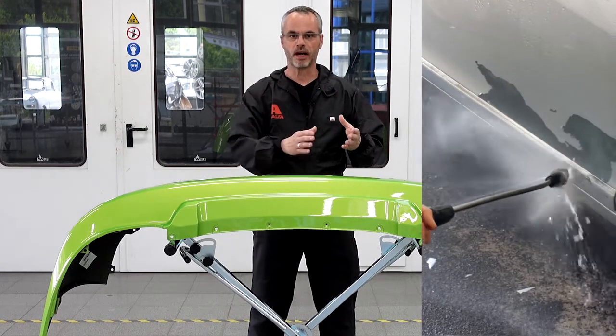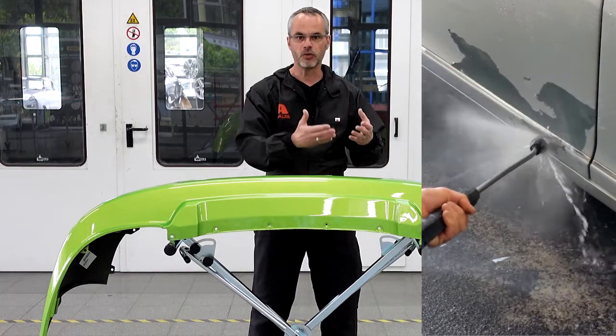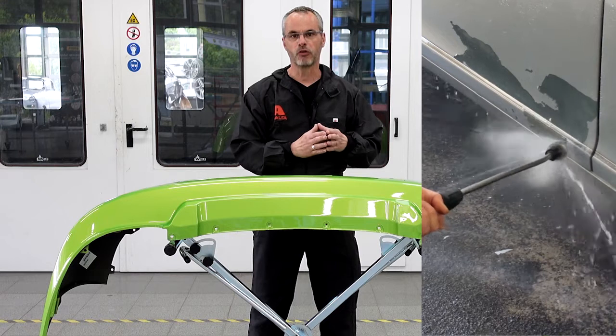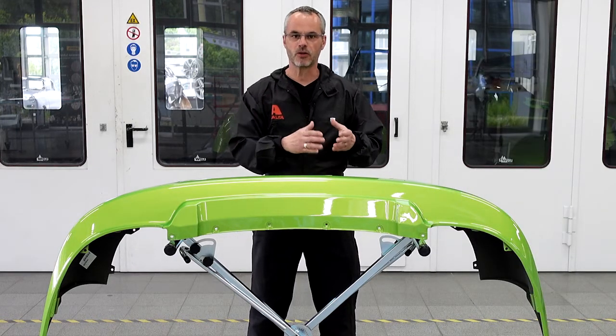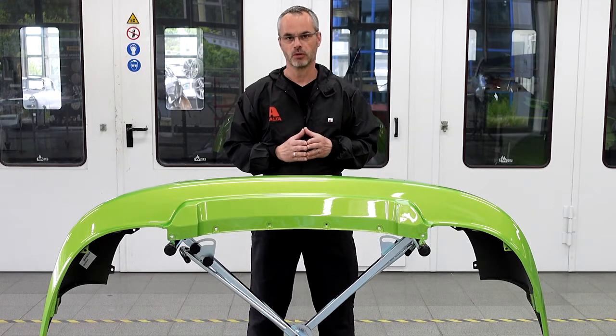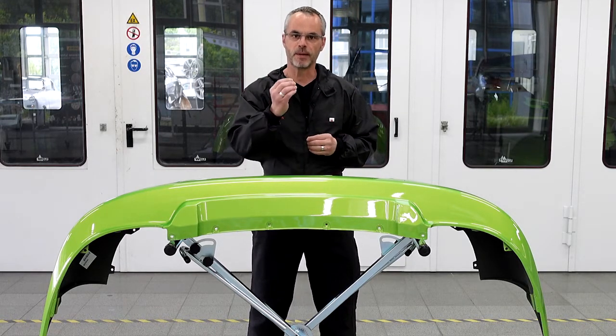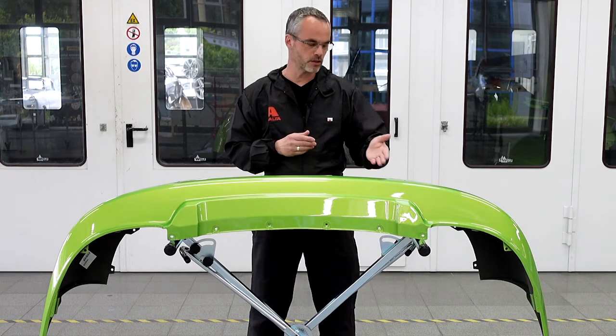Also cleaning with a high pressure jet cleaner too close or too early can create and cause delamination of all finish coatings. And be honest — who uses every time an elastic or flexible additive in both the undercoat and the topcoat? But this is so essential when it comes to plastic painting because remember it often starts with just a stone chip.